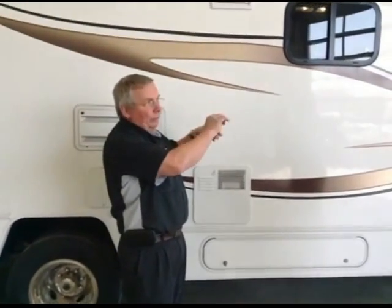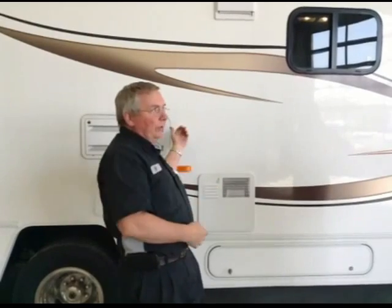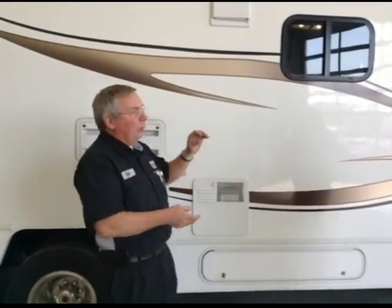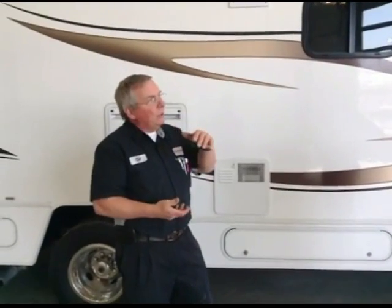So after you've got it all flushed out, same way with residential, you need to let it make ice. You can go behind the residential refrigerator, and on the back there's going to be a 1/4-inch line with a little T-valve in it for draining. You can open that up and let the water push out all the antifreeze to that point, and then do the same thing as you do with these refrigerators. Let it sit overnight and make ice, because it will work all that pink antifreeze through.